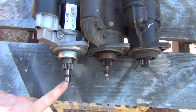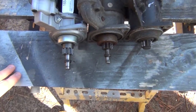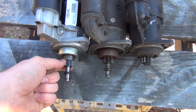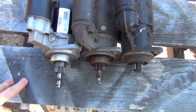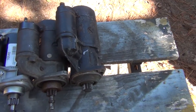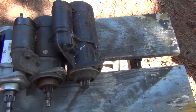This is a bus starter from 76 to 79, and you can see the difference in the starter shaft — that's the only difference. The starter shaft is a little longer, and the Bendix gear that you see right here is actually offset from where it is on the Beetle starter. Off to the right, we have an automatic starter, and this goes on to any Type 2, Type 3, or Type 4 automatic transmission.